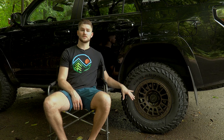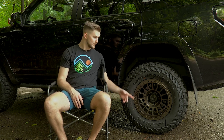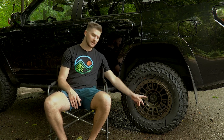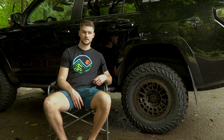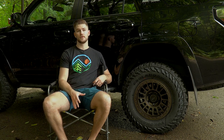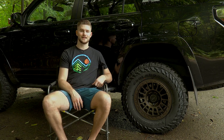The one thing I will mention is when I got these new rims, I had to upgrade to new lug nuts. Now, I bought new locking lug nuts from Relations Race Wheels. Unfortunately, a couple of them were misthreaded or something. So I've got a couple silver ones in there for now. They're sending me a couple new ones. So no worries, but that is why there's some miscolored lug nuts in there. So just know that if you buy a new set of rims, make sure that you buy the proper lug nuts for those rims, because the stock ones may not work after you swap out your rims. So that's really why I picked these particular rims, and I really like the way they turned out.